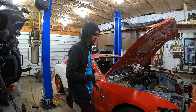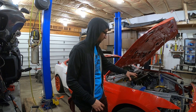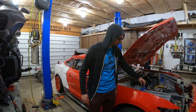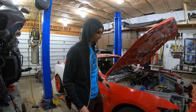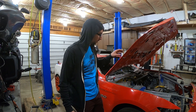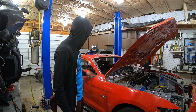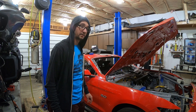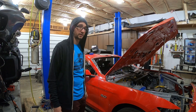For the chassis, we need to finalize the mounting up front for the tube front of the car — I've been waiting to do that until I get coilovers to make sure the bracket design will clear if we offset the coilover. We also have to finalize the tube front mounting at the strut tower and finish the B-pillar gussets on the driver's side. Other than that, chassis work is pretty much good to go.